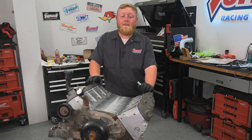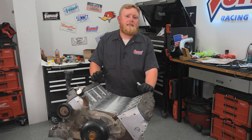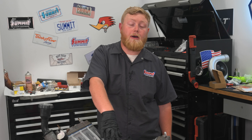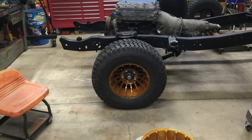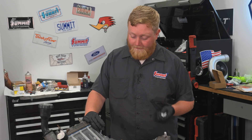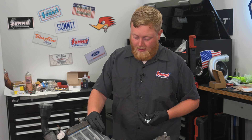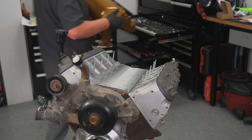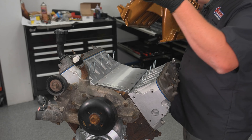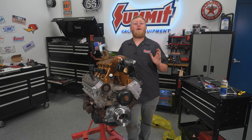Now it's time for our biggest piece of eye candy — the thing that's going to tie this all together — and that's our Holley high-rise manifold. I've gone ahead and thrown a Sniper EFI throttle body on the thing. This is going to be controlled by a Terminator X Max system because it is going to be bolted to a 4L80. We're swapping this into a 78 F100. The truck's got a sweet set of turbine wheels powder coated in a prismatic powders color — absolutely gorgeous. For the Holley high-rise, I need to go ahead and throw in the studs for mounting. This thing is color matched to the wheels on the truck, and I've gone ahead and pre-installed all the gaskets with a little glue on them. With our crown jewel on top, this thing is complete for the most part.